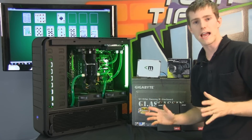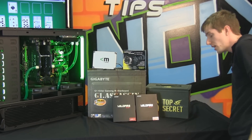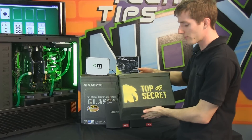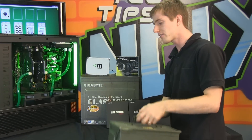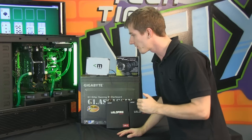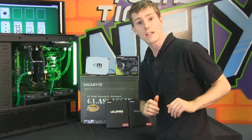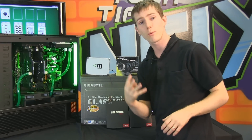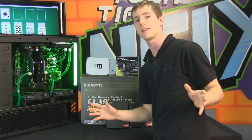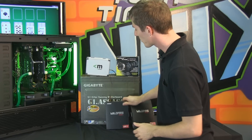You can see all these boxes next to me — they do have some meaning. We've got the power supply, and I think it's a bit of a stretch to call it a 1200 watt power supply since we've seen real-world examples of it pulling more than 1200 watts. Then we have our NVIDIA GTX 590s, and we've gone with EVGA classified water blocks to make these essentially EVGA classified water cooled GTX 590s — two of them in quad SLI. Two GTX 590s in quad SLI is the most you can have: three-way SLI uses three single cards, four-way SLI uses two dual GPU cards, or four individual cards. Running three 590s in SLI — six GPUs — is not currently supported by the NVIDIA driver, but who knows what's coming.